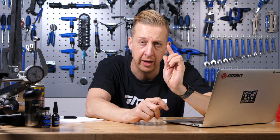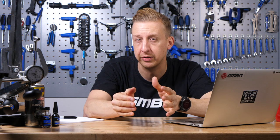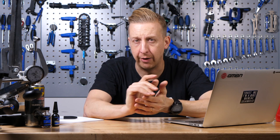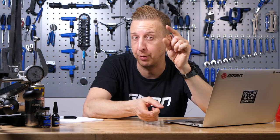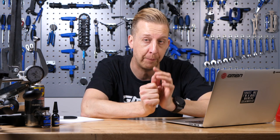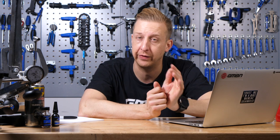That's the only downside as far as I'm concerned, because your frame has 110mm of travel out back. You always want slightly more travel on the front than the rear for better balance on trail. Going 20mm shorter up front might not be ideal. Also, the axle-to-crown measurement will be about 20mm shorter, which means you'll increase your head angle by about a degree — making it steeper, which is definitely noticeable. Some people will like that for agility, but it can also make the bike feel more nervous.